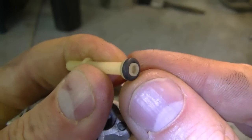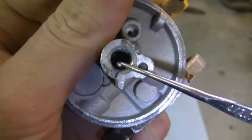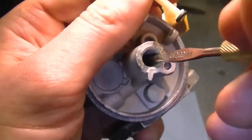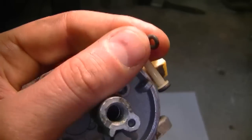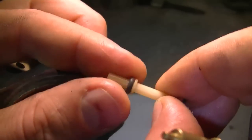As you notice, there's one o-ring on the tube but there's supposed to be two — there's usually another one down at the bottom. So you can go down with your crochet hook or your carburetor tool and just retrieve that other o-ring; it's usually stuck way at the bottom. And there it is — this is where that o-ring goes.